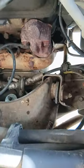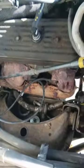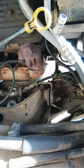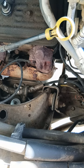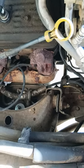While I was working on the truck, I found out that these bolts right here were loose. I had a little ticking sound coming from the headers, and come to find out that was just from them being loose. Pretty crazy.